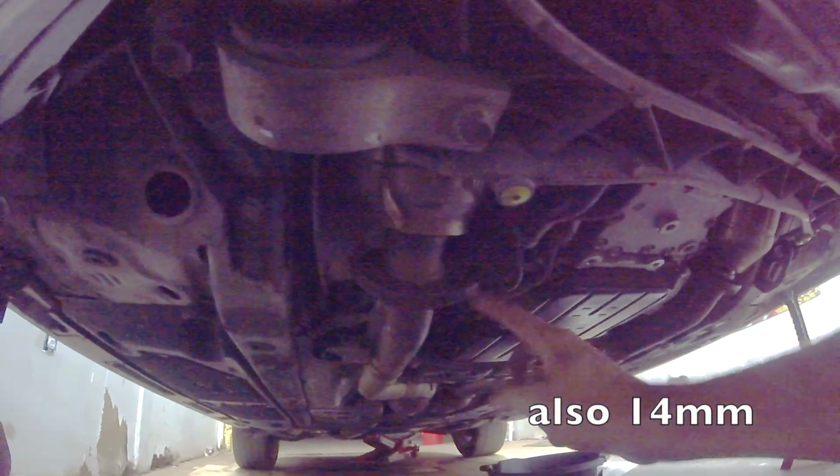the wheels. Then after that, there's the plastic under tray there. There's like 6 small screws that you take off for that. And then this piece is up here. It's bolted to the transmission there and the exhaust there on both sides. So you'll need a 14mm wrench and another wrench or impact to get that off. And then these two for the transmission are also 14.